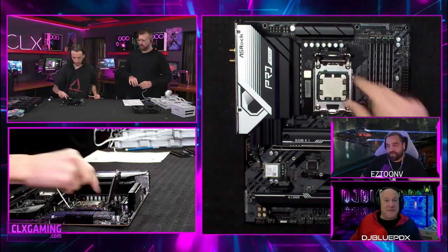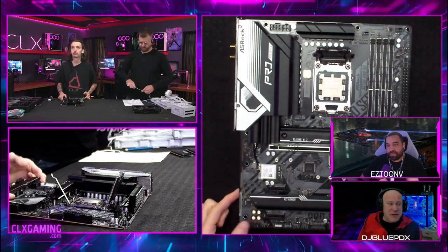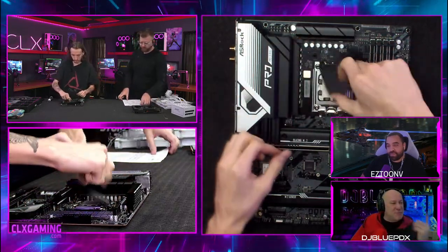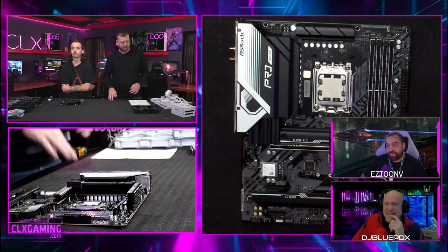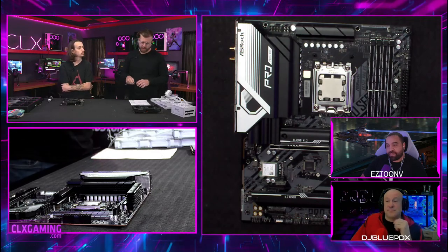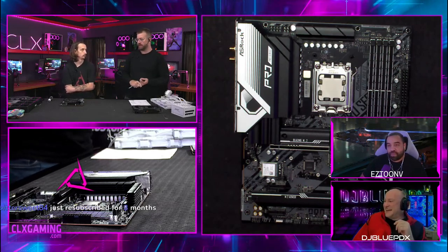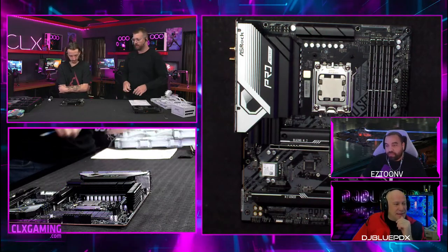I've done that. Speaking of things that are super fun, let's talk about that super fun little boxy thing that you just put in there. That is our CPU, our AMD Ryzen 9 7900X. Paul, can you walk us through that processor? Yeah, this is the new line from AMD. This is a 12-core, 24-thread processor using AMD's multi-threading technology. The base speed is 4.7, and it will boost up to 5.6. So that is a wicked fast base speed right there. Insane. Really solid processor.